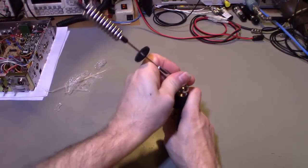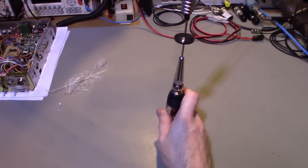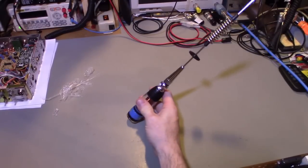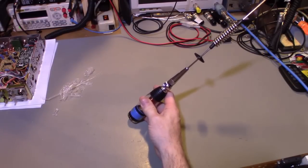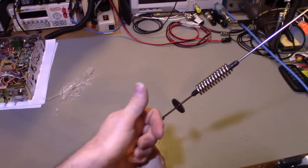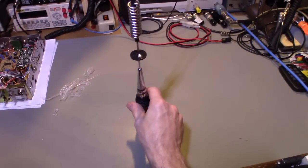Yeah. I occasionally see trucks going down the road. They'll have dual co-phased antennas on their mirrors, and they have their antennas leaning forward like this. So I guess they're supposed to look like bullhorns. I don't know. It looks stupid. But you'll also occasionally hear those people say, I can't get out to anybody. Well, yeah, that's because you're talking to the ground in front of you and aircraft behind you. You need to keep your antenna straight up and down.